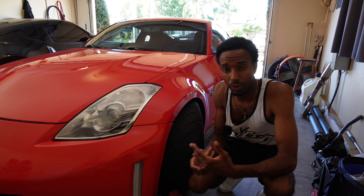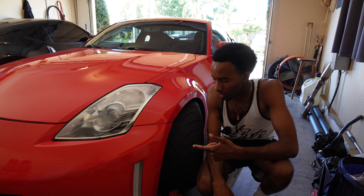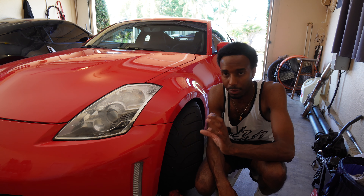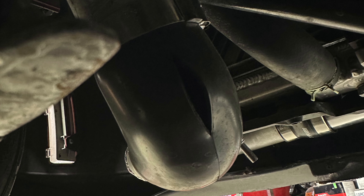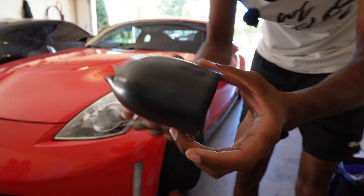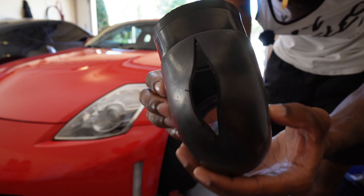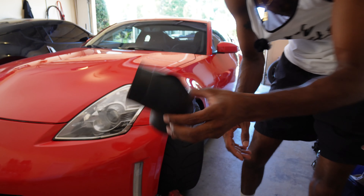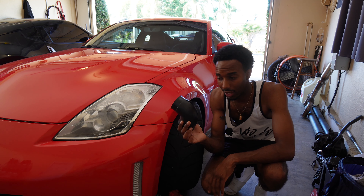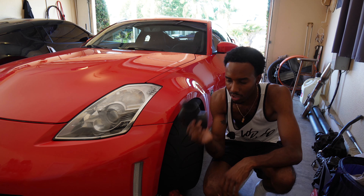In this part of the video we are going to be doing a little bit of preventative maintenance. Recently, a couple videos ago where I installed the new clutch and flywheel setup on this car, I showed an intercooler pipe coupler that was blown up — it was because it was a cheaper coupler. I have one right here for reference. As you guys can see, this is a 2.5-inch to 2.5-inch coupler and in the middle it looks like it grenaded itself because it did. And this is actually the second one.